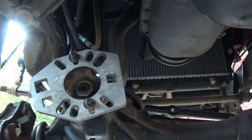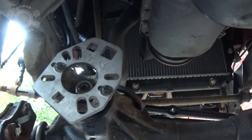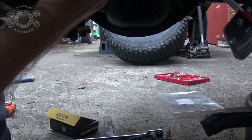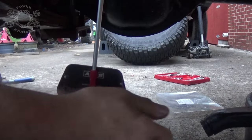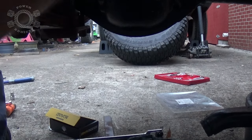And like I said a moment ago, the crappy part of this is that when we put the ring gear in and it starts setting up the mesh where the teeth mesh together, we may have to take this thing back apart again to move the whole gear back or forth. I hate setting up gears. Finally we're there. Whenever I move the torque wrench, it's not about how much it takes to make the pinion move - it's about how much pressure it takes to maintain movement. She's sitting right on 15 inch pounds. Personally I would like it just a smidgen closer to 12, because it's supposed to be between 12 to 15, but hey we're there and it feels good. It's smooth, so we're going to let her ride.